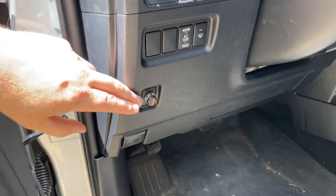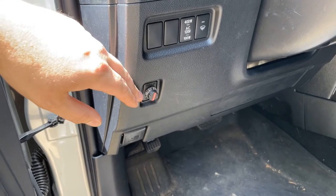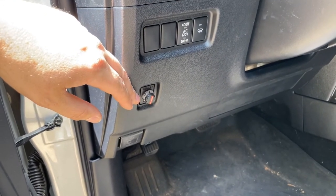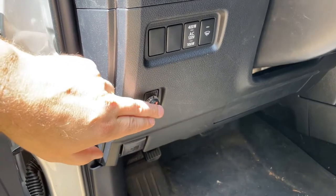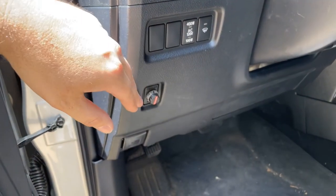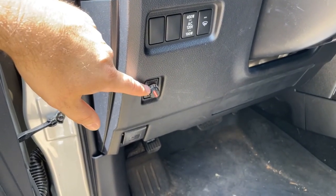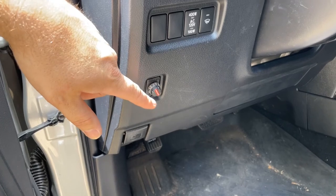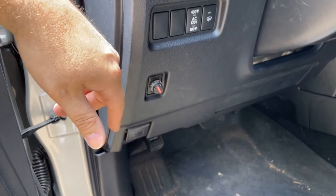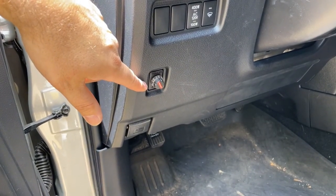Follow the instructions and videos on YouTube on how to install and calibrate it. You're really going to need a good piece of road where you can go very slowly — I had to go about a quarter to a half a mile before it fully calibrated. You can manually push it to activate it; it has LED lights to show your adjustment level. I prefer it in automatic mode — once calibrated it works really smoothly, anticipates braking, and applies gradual pressure. Towing this 4,100-plus pound camper it actually works really well.